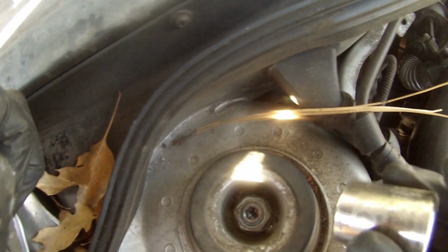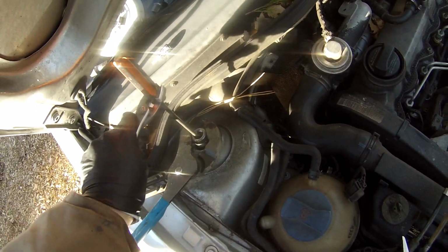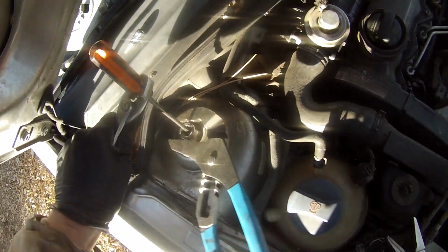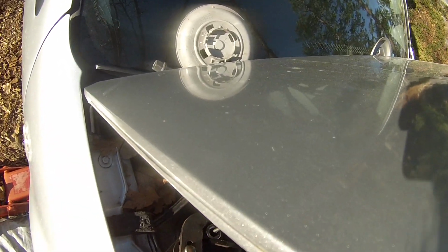So instead of going into town and getting the proper tools to do the job, well, I did what I do best, and I MacGyvered a way to get the nut off. Basically, I stuck that 21mm socket on, found a flathead screwdriver that fit inside the hex bolt within, and leveraged each one with a set of pliers. And hey, it worked. But seriously, don't be like me, kids. Get the right tools for the job.